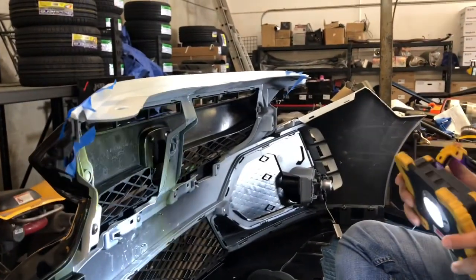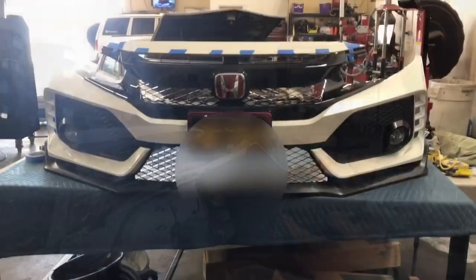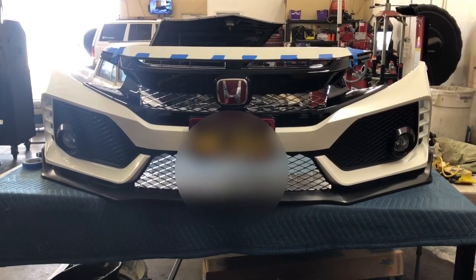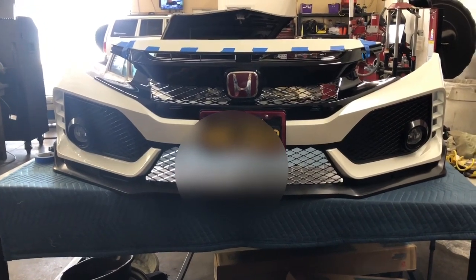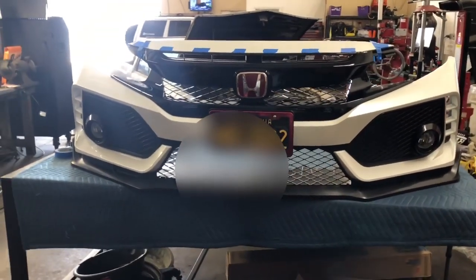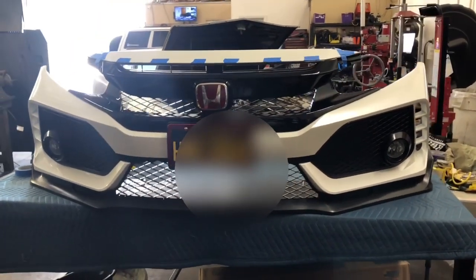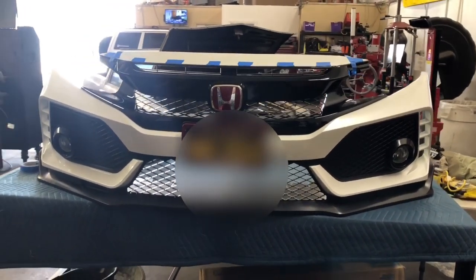That's all the step-by-step on how to install and assemble a Type R style front bumper cover, including the grill. For the finished product, the emblem was heated up off the old grill and transferred onto this one. For the plate, use some self-tapping screws first to make the hole, then put the original bolts on. Peel the tape and put the bumper on. If you don't know how to remove the bumper, I'll put a link in the description below. Hopefully this helps — I'll put links below for the items we use and sell.